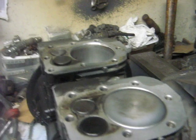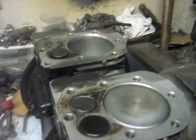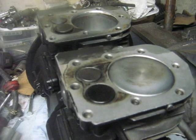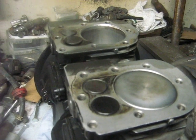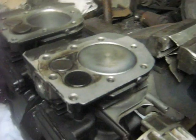The other way of doing it is to bring both pistons up at the same time. Then you have an even firing order, but it's basically kind of like a glorified one cylinder as far as balance goes, whereas hopefully this engine is balanced better.